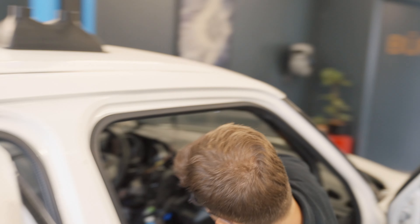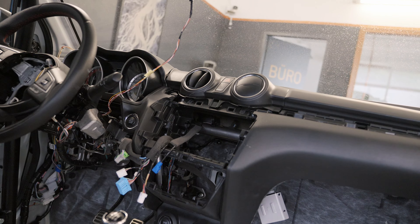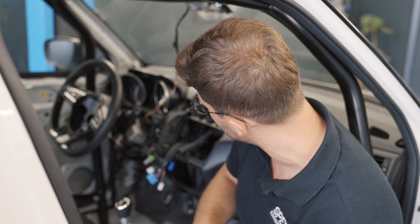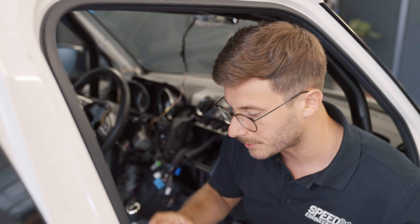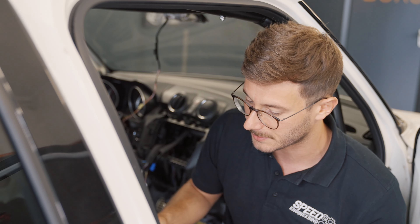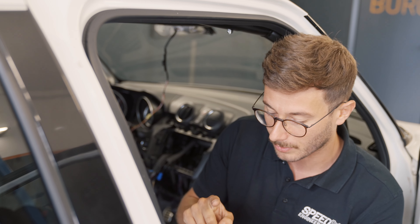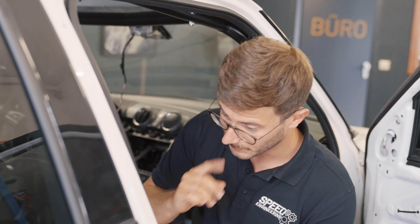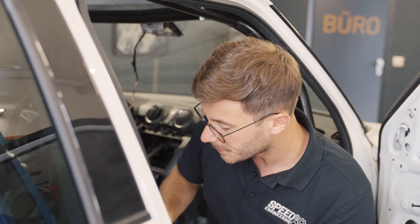You can see there is a huge hole where the OEM display was — we won't use that display. What we are doing is using our next generation monitoring system. We bought a display which is exactly the same size as the OEM one from Suzuki, so you won't see any difference. But when you turn on the car there will be lots of different values — we have a measurement system for oil, gearbox, water, turbo pressure, and all that. We also have a system to measure tire temperature on the outside, middle and inside of each tire surface, so you can monitor everything necessary for a race car.